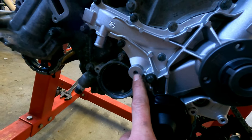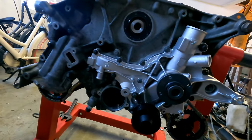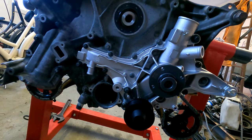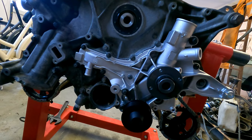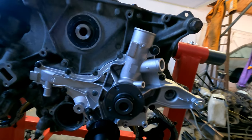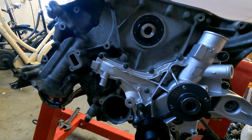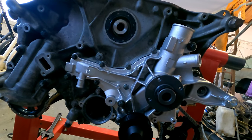But it's an M8 bolt. All the other M8 bolts in the block are 20. People that have more experience with engines and putting bolts in aluminium blocks know, and it would not be the first time that you damage a thread. So I put all the M8 bolts to 20 newton meters, also these in the pump, because they are all in the same block. So I put them all in on 20 newton meters, and it feels correct.